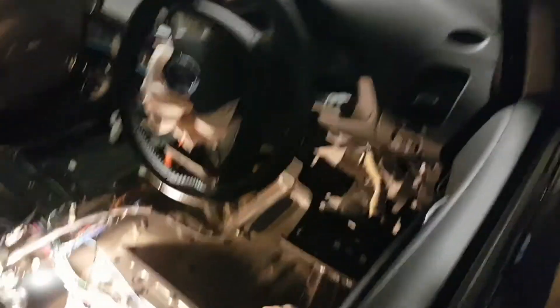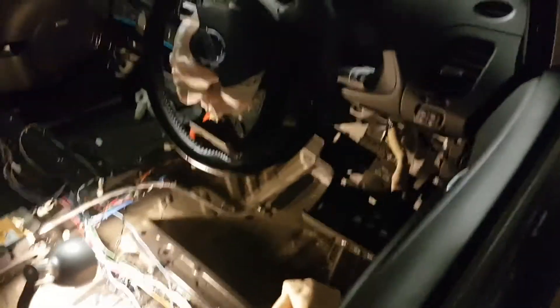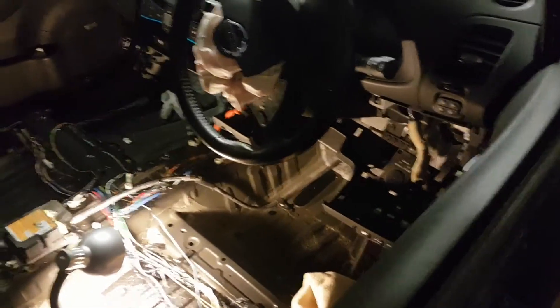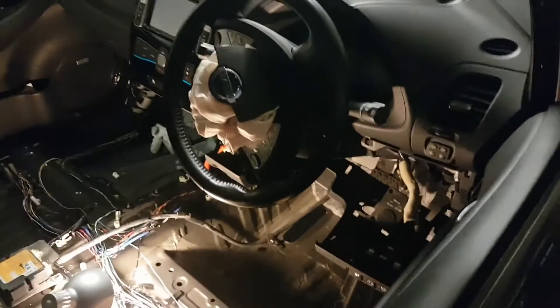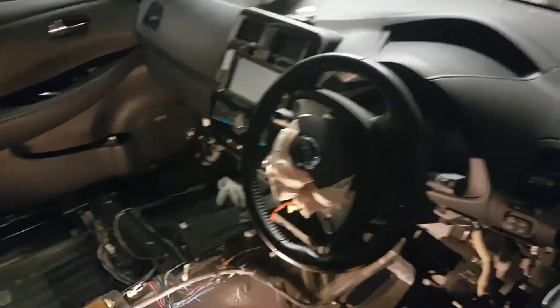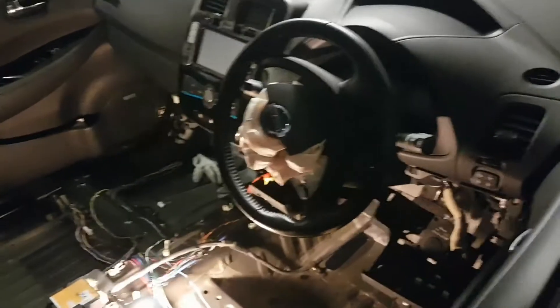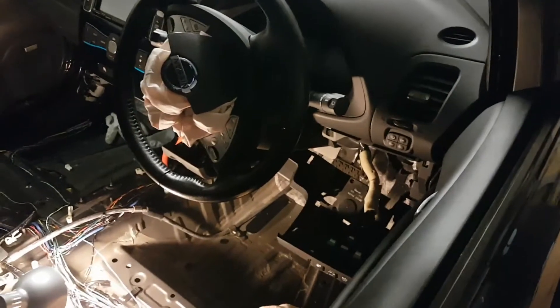I would also say if you're interested, the heated steering wheel is a significant piece of work again. All the harness is all wrapped together, so you'll have to strip down the harnesses again to do that. I would recommend instead you look at the pin out on the connector going into the heated steering wheel and into the switch on the side, and repin it and run it across to the relay. The relays on this car are all at the far side, near the fuse box. So this harness is going to route all the way across the IP, which is pretty difficult access. Don't recommend doing it — substantially more work than it's worth.